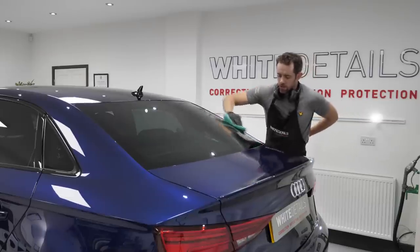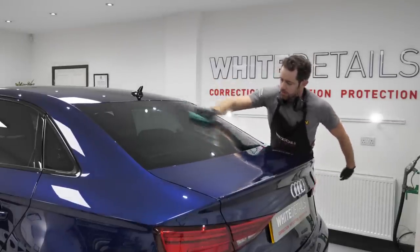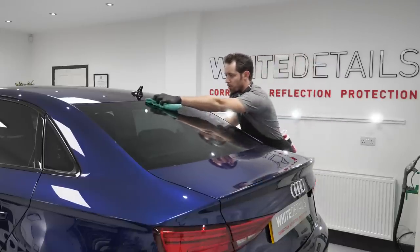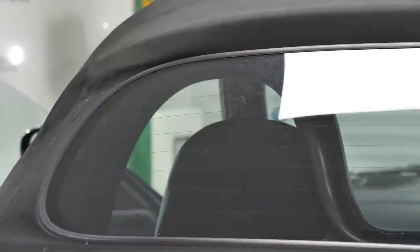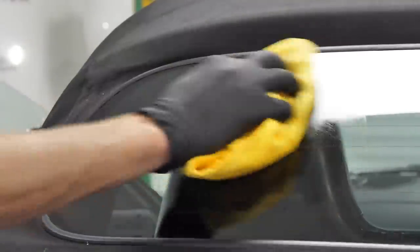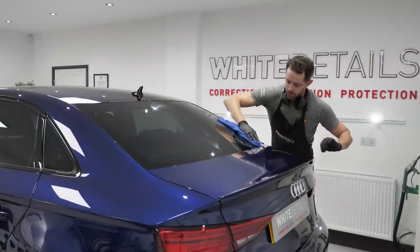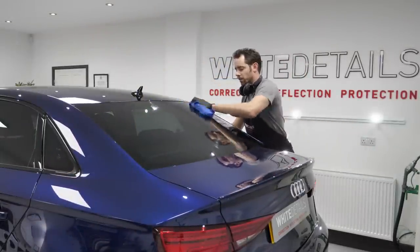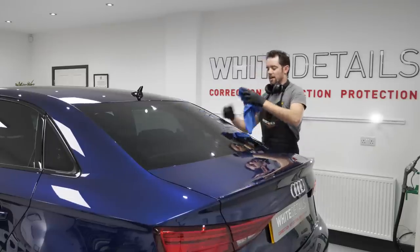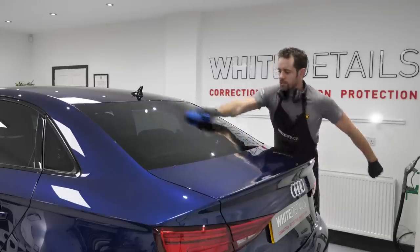Geon Water Spot, the water spot remover I flashed up and showed you. I'm not using it on this job, it doesn't need it. The car is well cared for, it's well maintained, there are no issues with spots. But panoramic roofs, which are exposed to baking sunlight and pollen and dust and the water sits there for periods of time, it is common for water spots to occur. On the bottle of Geon, it does say can damage glass if used and allowed to dry. It doesn't say don't use it.